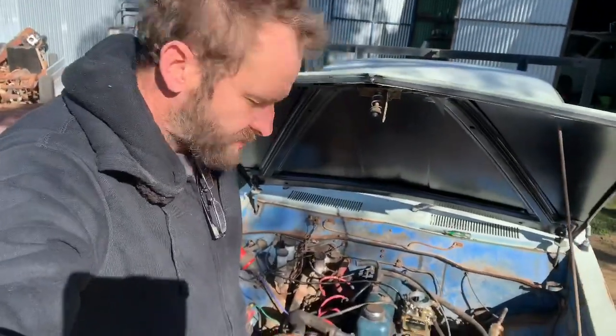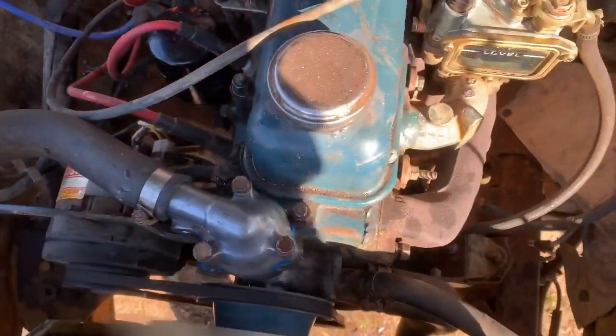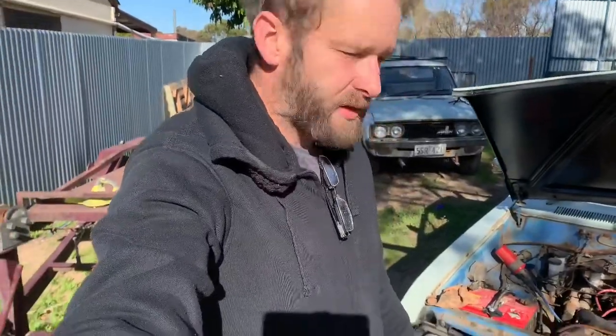As you can see, the head gasket is done. The problem is I have a blown exhaust manifold gasket, so I have to order one of those and I won't see that until next week. So no driving of the ute this weekend. I'm going to wait until I've got the manifold gasket, put that in, get it hot, and readjust the valve clearances. Then it's all set on the road again. Okay, that's it for now — I'll see you next round.